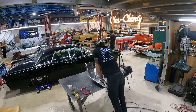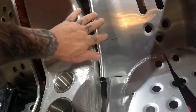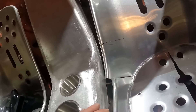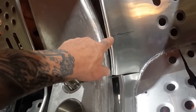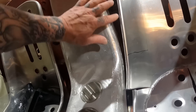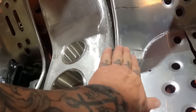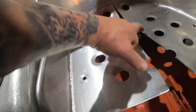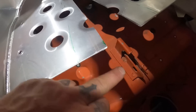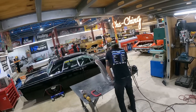The front seat is cut up like a little piece of pie and set back in here. He's got the two sides cut and rolled over with relief cuts on both sides. At this point, we're going to make another relief cut up top to try to get the upper section manipulated back a bit, and get that section to fold over. The front came out pretty nice — we'll have to weld a new piece of aluminum in here, then he'll roll it and bring it down to the base of the floor pan. I think we're on the right track.